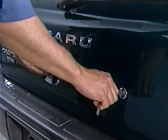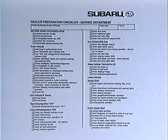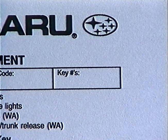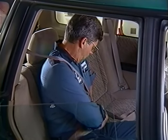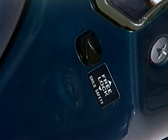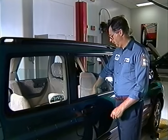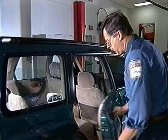Make sure the key locks and unlocks both front doors and the rear gate. Record the key numbers in the box on the check sheet — the number is stamped on a metal tag on the key ring. Check the rear seat belts and make sure they fasten properly. Make sure the child safety door locks operate properly. Set each lock, close its door, then reach through the open window and pull the rear door handle. Afterward, leave the door in the unlocked position.